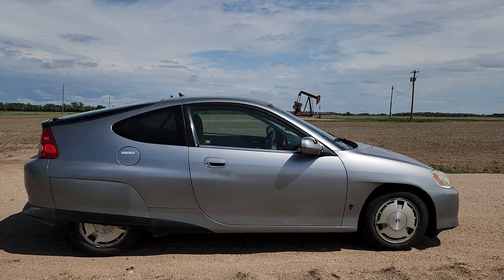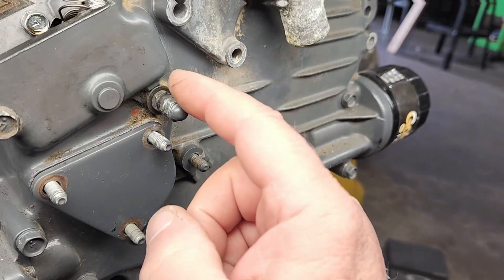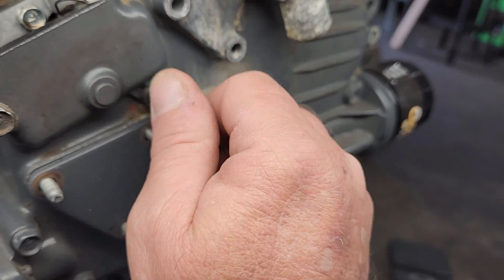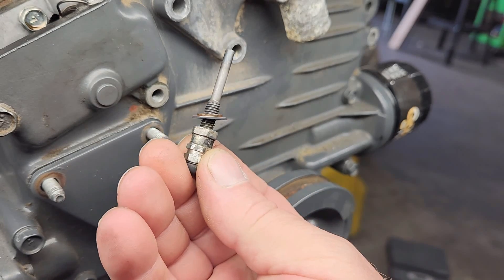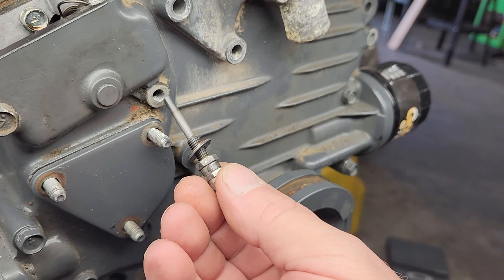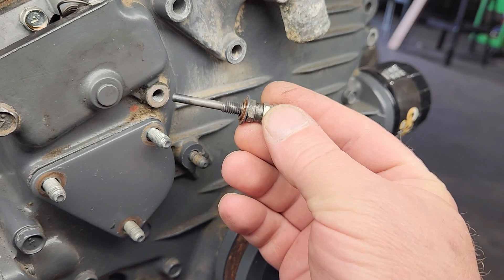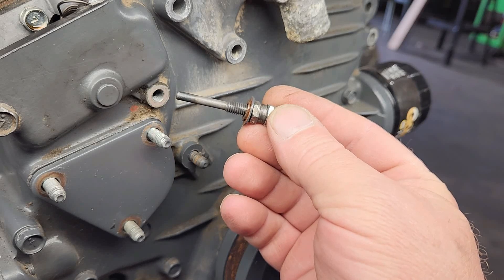Let's check out the progress of the various gizmos we're developing to enhance the performance of this engine. This is the fuel rack adjustment screw, and it's calibrated at the factory so this engine can more or less run forever at maximum rated power. As it turns out, you can adjust this screw for more power if you add boost to the equation. If you adjust this screw without adding boost, you can destroy the engine because the exhaust gas temperatures will go beyond the design limits and the pistons will melt. So we do have boost, and now we need to be able to actively adjust the fuel rack limit depending on how much boost we have.